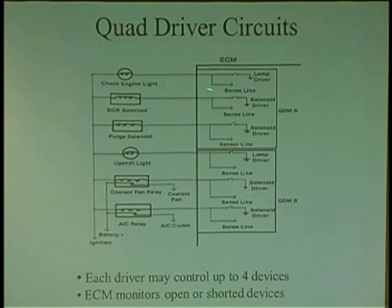We talked about driver circuits, all right? Basically it's going to look to make sure 12 volts comes in, and it's going to ground the circuit, and there's one guy inside. His job is to go, okay, ground it, it's high, go low, and he goes low. Every driver circuit has to go from high to low if it's a grounding situation, not one that pulses it.